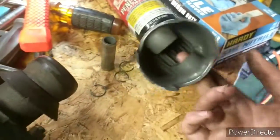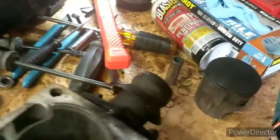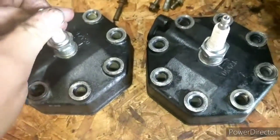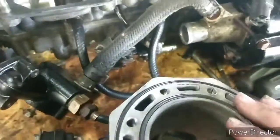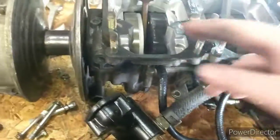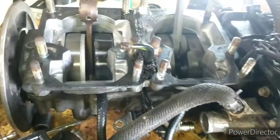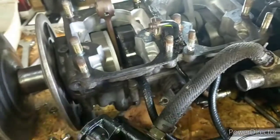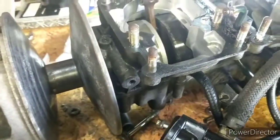And this is the second piston for two-cylinder motors. And then we have all the wiring stuff for spark. You also need a coil to give yourself spark that is still on the sled. And this motor has an oil injection pump to pump the oil in for pre-mix, so you don't have to mix the fuel and still run a two-stroke. A lot of two-strokes don't have oil injection, so you don't have the oil injection pump in here. That way you just mix the gas.